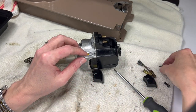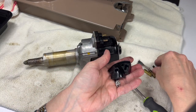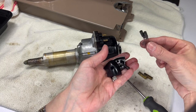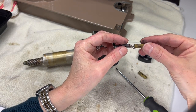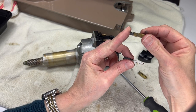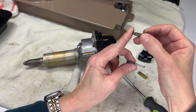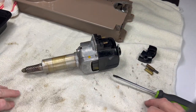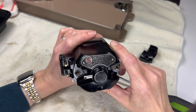Setting this aside: I have the covers for the brushes, the screws that hold the covers on, the carbon brushes themselves, and these little brass inserts. The spring goes down inside and the carbon pushes in - the spring is what allows the carbon to gradually release and press up against the commutator. Pretty simple.